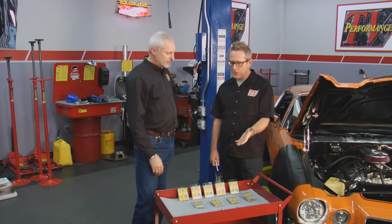That's exactly right. We can prevent even that first degree of counter rotation. And only 5 degrees of counter rotation costs you 50% of your clamp value. All of a sudden, you're blowing header gaskets and you're doing what we're doing today. Well, explain to me, how does it keep from backing out? How does it lock itself?